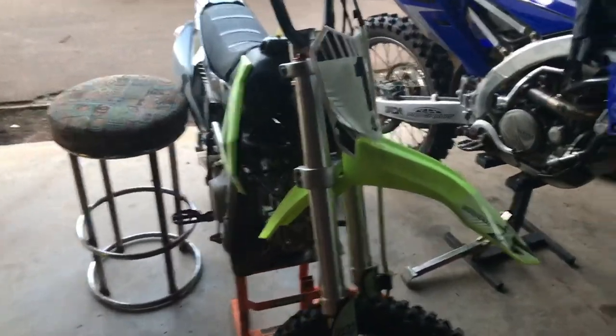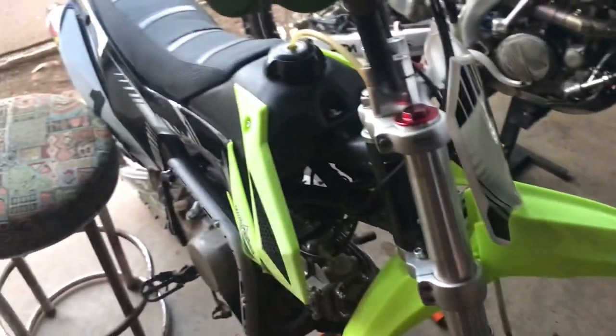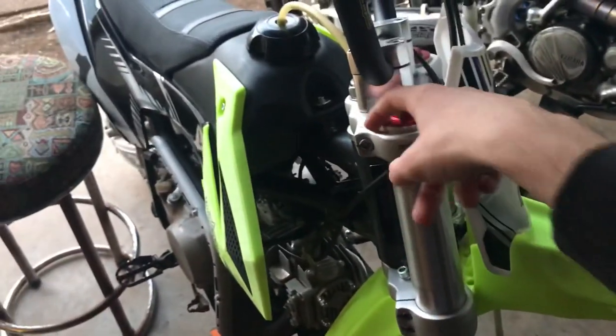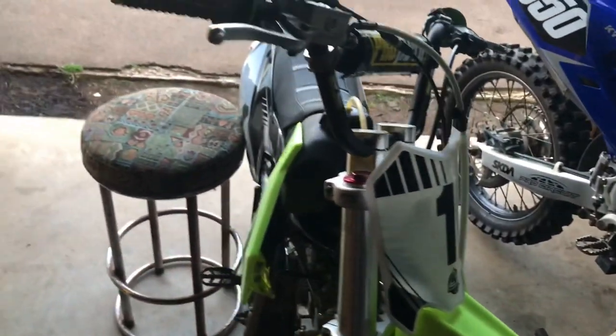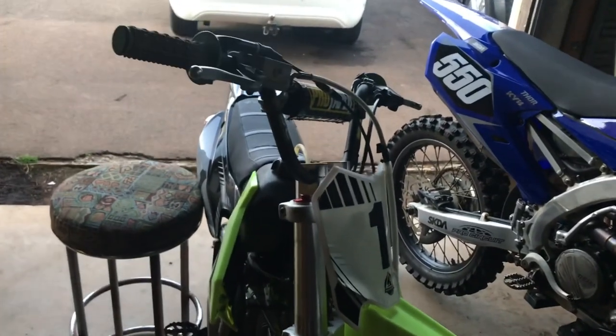This next one is a little bit more complicated but also basically free — all you need is a little bit of engine oil. What you're going to do is empty out the stock fork oil and replace it with new oil. Take your front wheel off or remove your forks, but before you remove them all the way push them down a bit and tighten it so you can crack the lid open — because you can't get it under the bars. Once you crack that lid open, push them out the bottom, take the lid completely off, measure how much old oil was in there, and put some new oil in. A 10w40 or similar oil will be much thicker than the factory oil. The oil that came out of this bike was basically water — it wasn't too good.